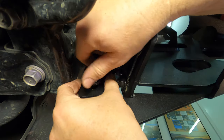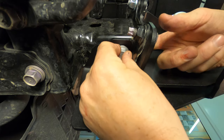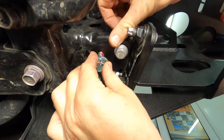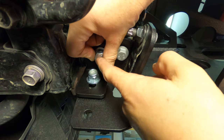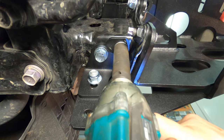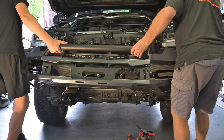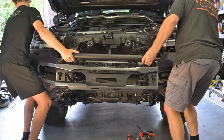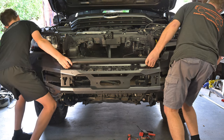Now move to the underside of the chassis and fit the two supplied gusset angles. Loosely install the supplied M12 bolt and nylock nut to the gusset and the bar bracket. Then apply Loctite and install the two supplied bolts into the bottom of each chassis rail, with the coarse thread bolt going into the front teardrop nut and the fine thread bolt going into the rear factory captive nut. Fully torque all three of these bolts to around 125Nm. With an assistant, carefully lift the bar onto the car, sitting it on top of the brackets and ensuring that you don't damage the headlights or the guards. You'll have to tilt the bar to be lower at the back to get the wingtips under the headlights as you slide it into place.